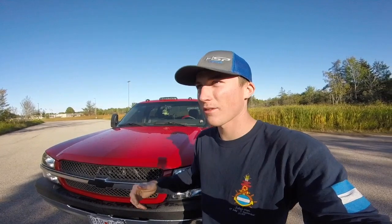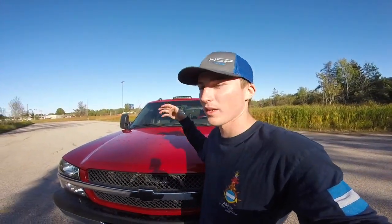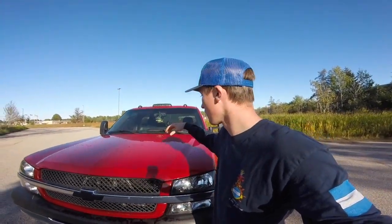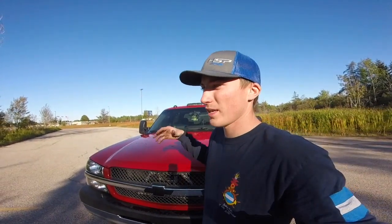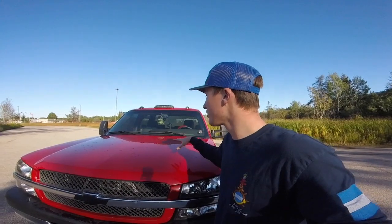So after that's taken off, if I'm not mistaken, because this was this week sometime that I did all this, next we're going to be doing the hot side intercooler pipe, which is also super easy, guys. Disassembly on all the piping is super easy. So hot side is going to be the same thing, 7/16 deep socket.